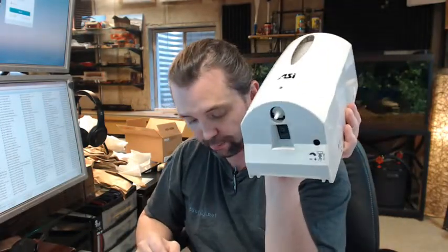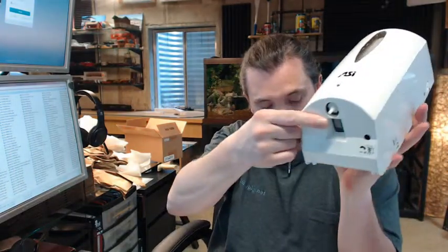Place your palm below — the sensor will activate and the motor will pump 1 to 1.5 milliliters of liquid soap. If you need more, repeat and wait 1 second between activations. Do not scoop soap from the nozzle — just let it come down, as touching it could damage the installation. For installation check: make sure the unit is firmly attached to the wall, the cover is closed and locked, and batteries are installed. If the red LED flashes 4 times, it indicates normal function.